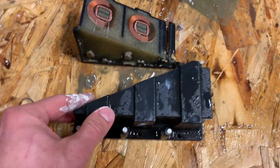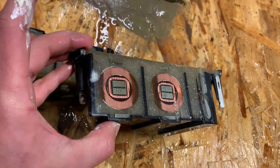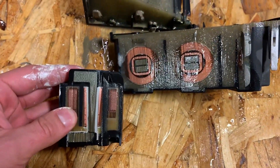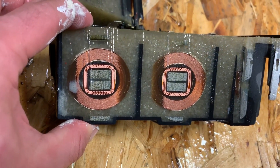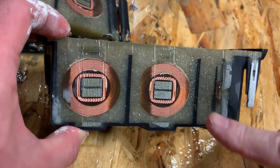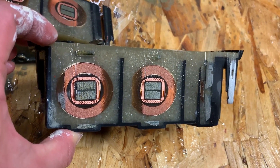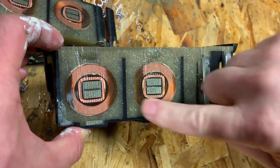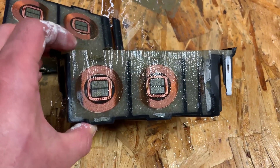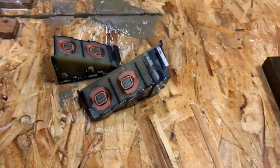This is the exact same thing — we cut this one on an angle though, so it gives us a slightly different view. This inner coil is the primary windings, connected to the 14-volt — 12-volt — 14-volt, just straight out of the battery system. As that thing is turned on and off rapidly, the magnetic field, like Mitchell said, when it collapses it creates a very high voltage signal which then goes to the spark plugs. So it's going from 12 or 14 volts up to about 20,000 volts when it goes to the spark plug? Yeah. I can confirm.